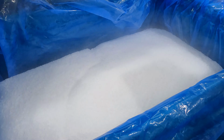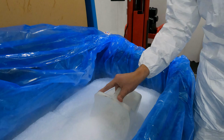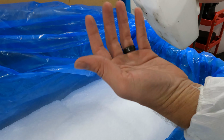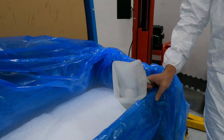Yeah, this is awesome. Dry ice blasting is an incredibly satisfying and extremely safe media, as opposed to using walnuts or sand or something that is actually trying to attack surface oxidation or strip paint. We can utilize this dry ice, which is in pelletized form, and put it through our dry ice blasting machine and essentially gauge the size of that pelletized ice based upon how sensitive of a surface we may be working on. Some people use these for wool carpet interiors for coach-built cars, but a lot of people nowadays are using them for sales prep to remove factory cosmoline, to remove any road grime or oil leaks that may have accumulated on an underbody in particular.